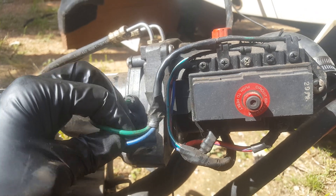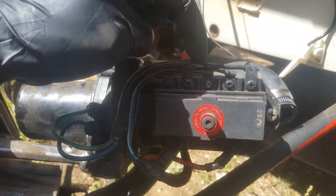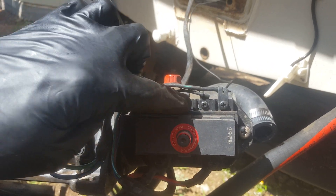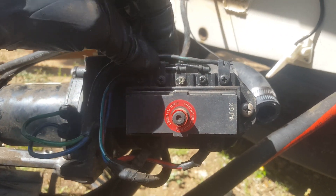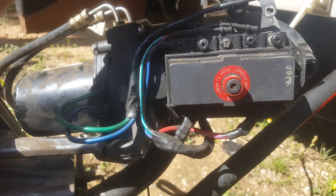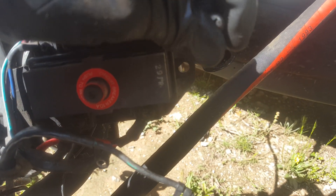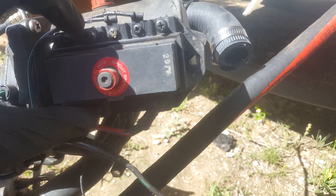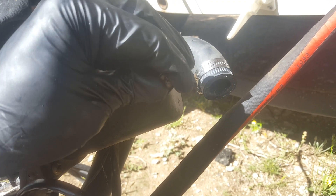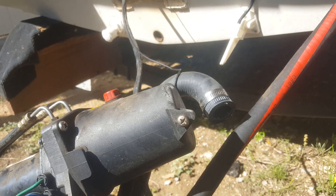A trick to mention: you have two wires — green and blue — connected with larger screws. You can remove just those two and pull the controller off, so you're not having to break five different screws. Just take the top one which is your green, and then the one which is your blue. Green and blue removed. Then there's a larger Phillips right here — remove that, and this wiggles up. Don't forget to save your Phillips.